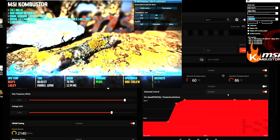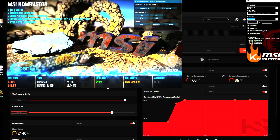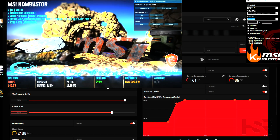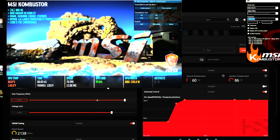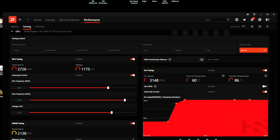If you get to 1100 mV without problems, do a three-minute test. If it's fine, reduce by another 10 to 1090, then 1080, and keep doing three-minute tests to find your limit. Whatever you end up with is what you save. Note: if it's stable for three minutes but crashes after an hour of gaming, that may be the undervolt being too aggressive — increase it slightly if that happens.